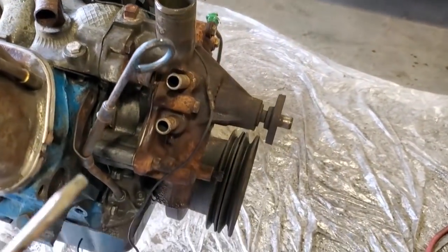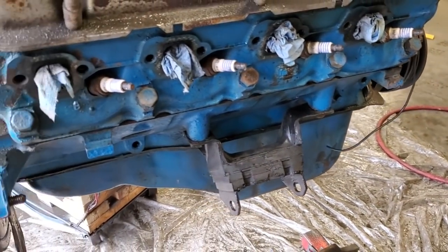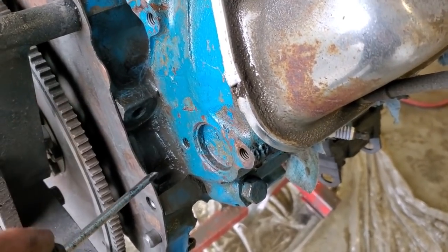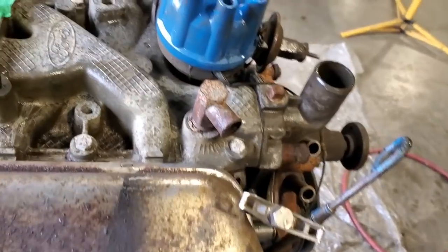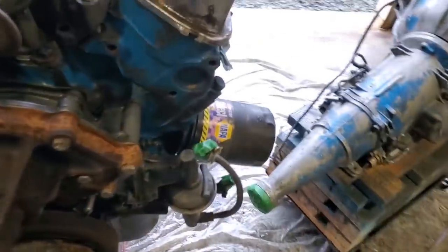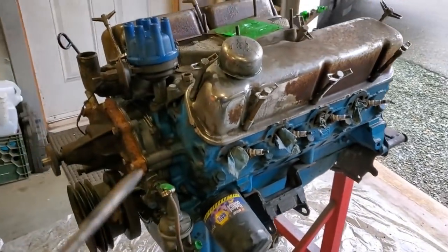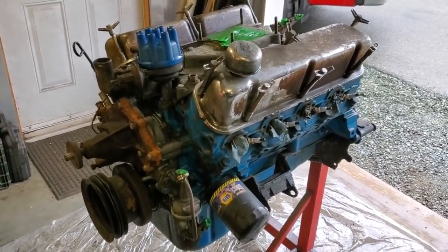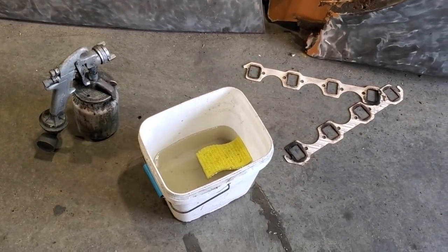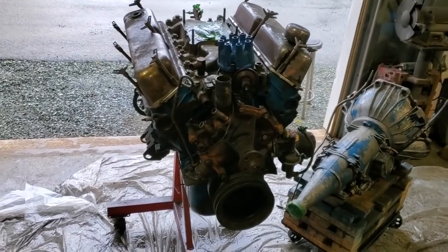After going over it twice, I'm going to go over it once more. It's come out really clean - I'm amazed with how clean it came out considering the state it was in. I've got some spots I went around and dug out. I blew the whole engine off with compressed air, went up and around, dug those out, and cleaned them all up - just scraping and loosening up the dirt before I give it another douse of Easy Off oven cleaner. Done the same thing with the transmission. A full bucket of water and I'm after rinsing that motor twice. You don't make too much of a mess that way.